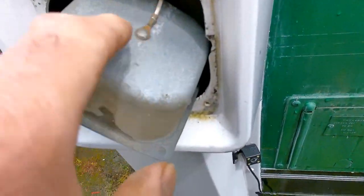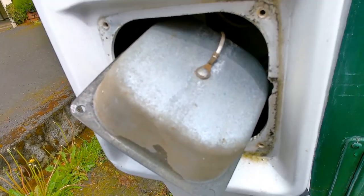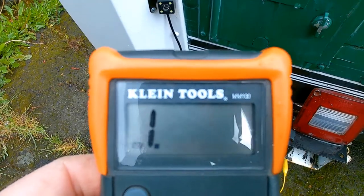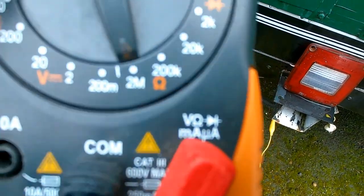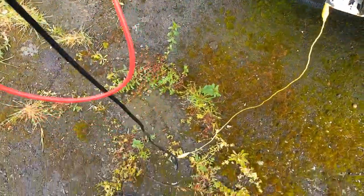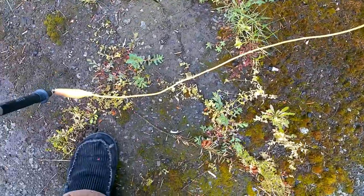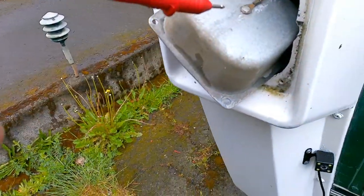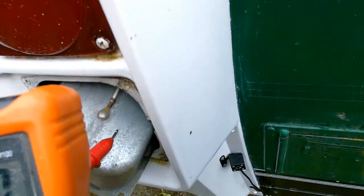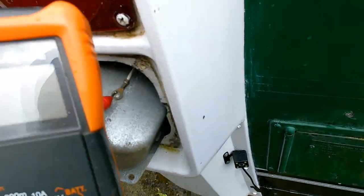Make sure that this wire is actually grounding this base. So this is how I did it. Just take your multimeter and turn the dial to the ohms setting — that's resistance. From the negative wire, I put a crocodile clip from the end of the negative probe to the chassis. And then the positive probe, I'm going to touch to the casing of the light and see what happens — see if we have any connection there.